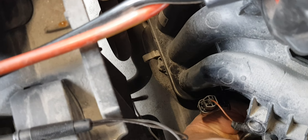Now I'm going to connect the plug and socket here and try to reset the DTCs. After ignition on, I'm going to wiggle the wiring and see what happens. The engine warning light is off, engine is running — I'm going to try to wiggle the wire.